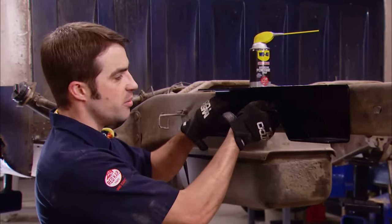A little WD-40 will help lubricate the caps so they slide out of position a little easier. I'm using a nut from one of the old rear axle U-bolts to drive on the bottom of the U-joint and help push the top cap out — it's just better than using a chrome socket.